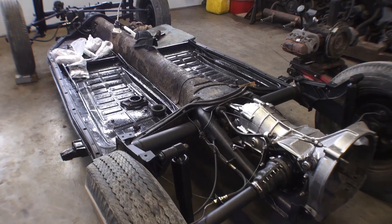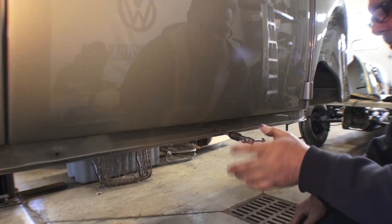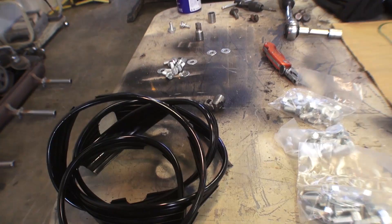And there's our chassis — a body-off restoration. We love doing restorations this way; it makes the car come out supreme. And if you have your running boards still off, you could also tap your running board threads while you're at it — that's a six millimeter tap.